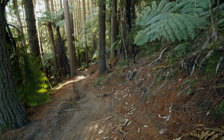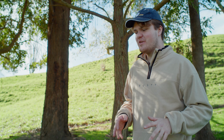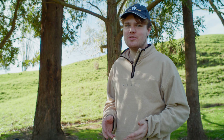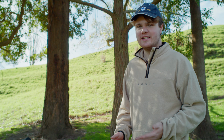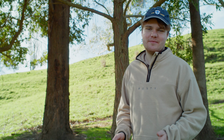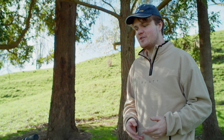I was really stoked on the hub at first. The silence is really cool and it has quite a unique feeling on the trail when the bike's just dead silent. But the fact that that lack of noise just comes from a lack of engagement has kind of left the honeymoon phase for me. The lack of engagement does hinder the bike's technical climbing ability. I feel like there's been quite a few sections where I would have cleaned it if I'd had a faster engaging hub. It's just something that's always in the back of your mind when you're coming up to a really root infested climb. Fortunately, I can fix this by putting in the 54 tooth ratchets for the low cost of an entire new hub, which I'll probably end up doing.